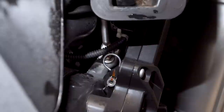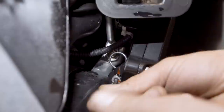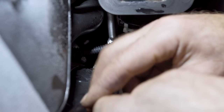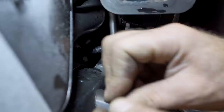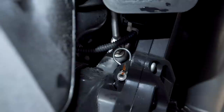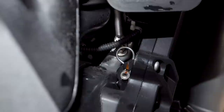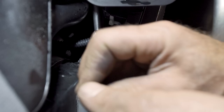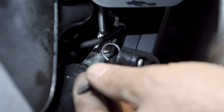We checked and we could see there was a fair bit of play. They don't ever need much more than finger tight. So there's one turn. There's a flat spot which rides on the pin and that keeps the retainer in the right spot. We're about a turn and a half — about as tight as I can get it — so I'm going to back it off to the flat spot and you'll feel the detent where it's seated on the spring. Then I'll go back over and wiggle the secondary back and forth. You can feel that's about as tight as it wants to be. If there's lots of play it'll rotate quite a bit. Try to stop on that detent if possible.